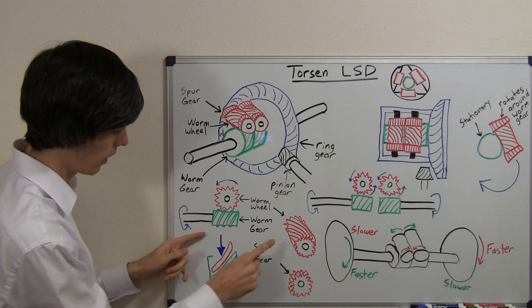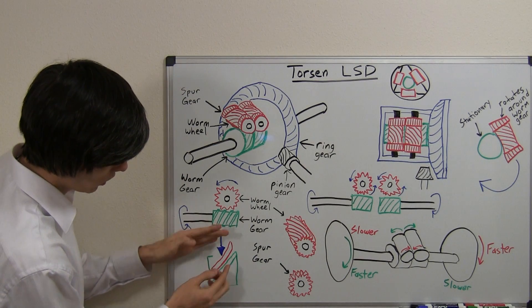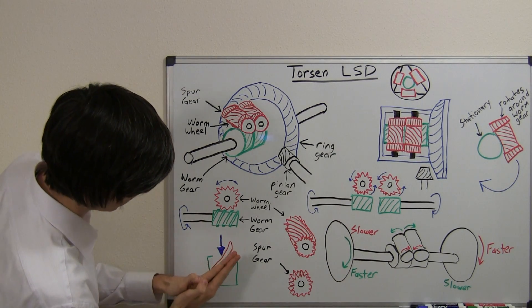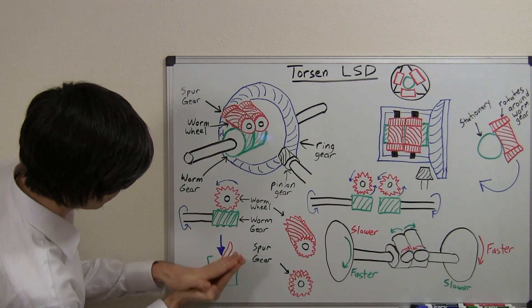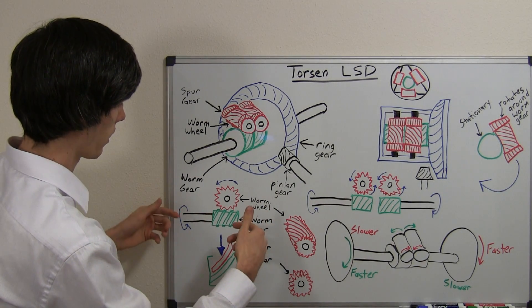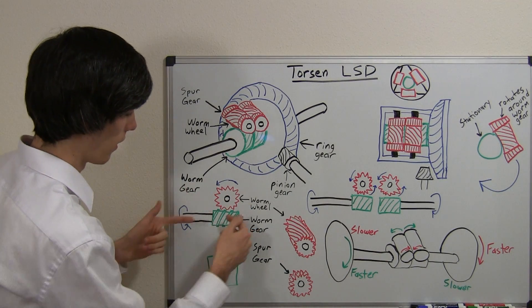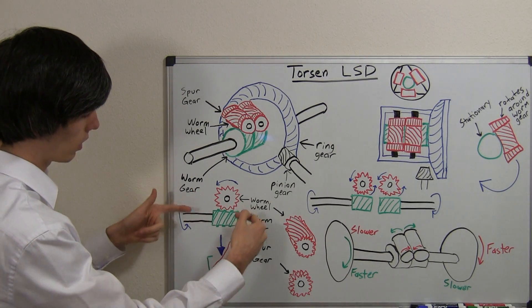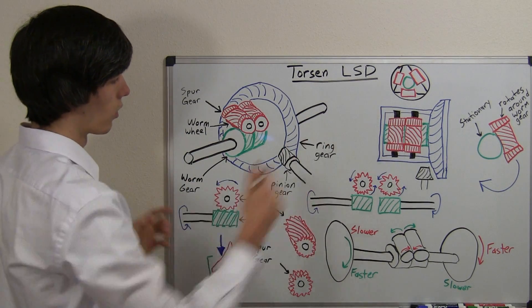This is helical, remember as I've shown here. So when that force comes down — this is what it really looks like — you've got this helical gear meshing with another helical gear and it's going to push it down. As it pushes it down, it can't rotate the gear in the direction that the gears rotate. So instead it just rotates it forward, and while it pushes it forward it rotates this drive shaft. So both of these drive shafts rotate forward.